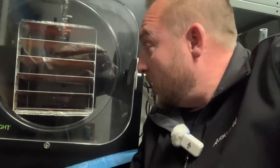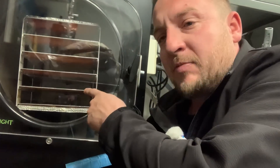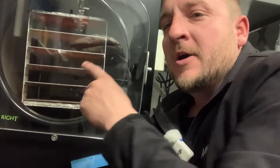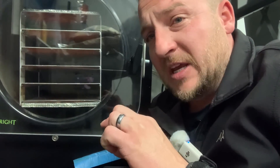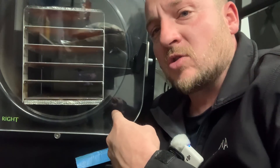Here's one of my Harvest Right freeze dryers. How it works is it cools the entire compartment down to really negative temperatures, then turns on a vacuum pump to create a negative pressure environment while the heated trays warm the food up. The moisture from the food turns from a solid to a gas and back to a solid around the chamber. It kind of senses how long it needs for drying, but previously I just felt if anything was cold — meaning there's still moisture and it's not fully dry. With the thermal imager, all you do is plug it in your phone, open the app, look at it, and if there are any cold spots, stick it back in the freeze dryer because it needs more drying time. You're not going to spoil your food by packaging food that's not completely dried.